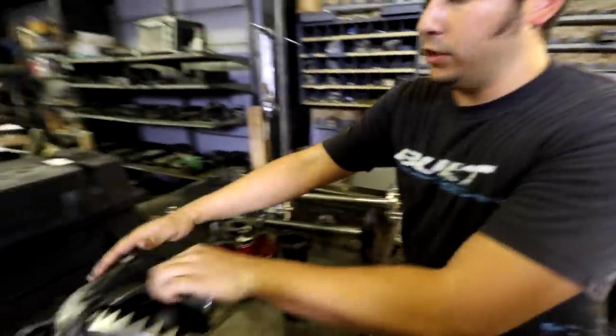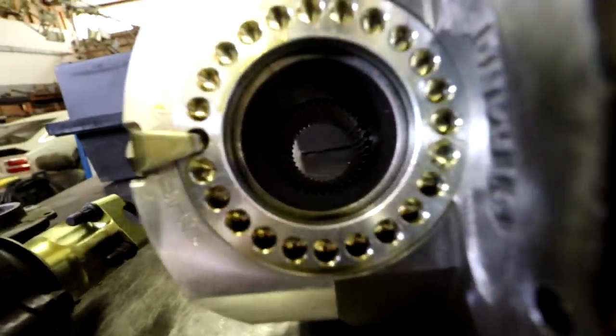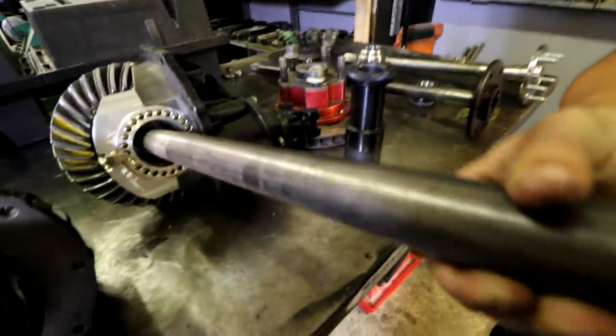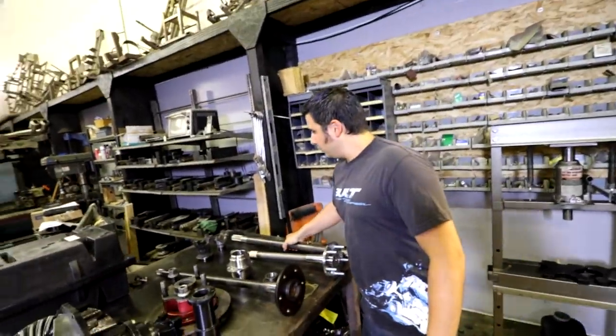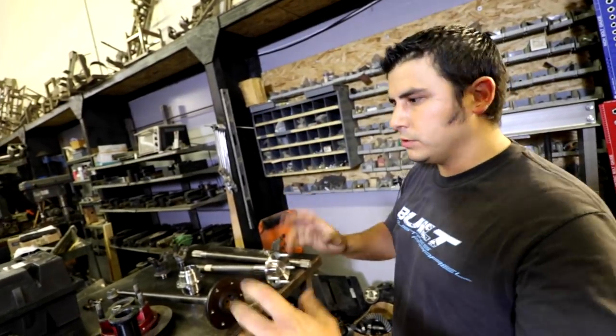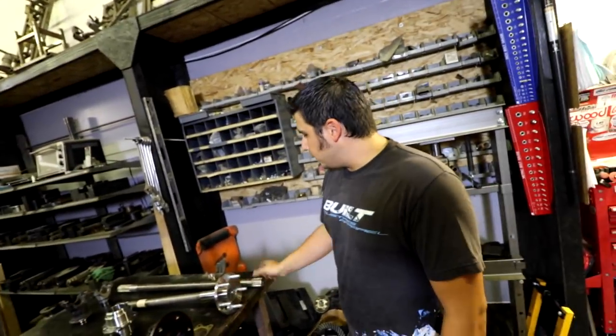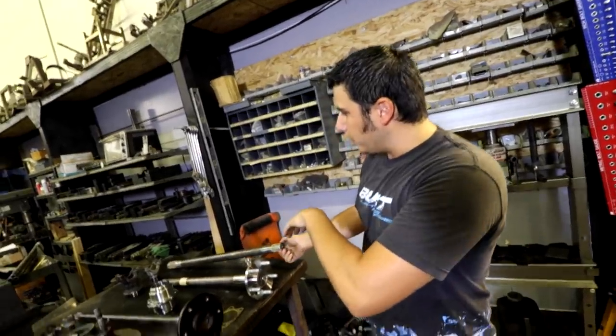And then you go into jumbo 40 and then jumbo 36, which is like a trophy truck, which you can see. So this is a pretty good size axle, let's just say. And then that's the trophy truck axle. You can tell that the trophy truck axles are significantly larger, and they're actually hollow. They're gun drilled to allow some twist. So this is what your big trophy truck axle will look like as far as the spline on both ends, but the diameter is much bigger.